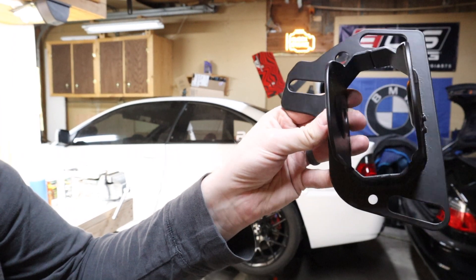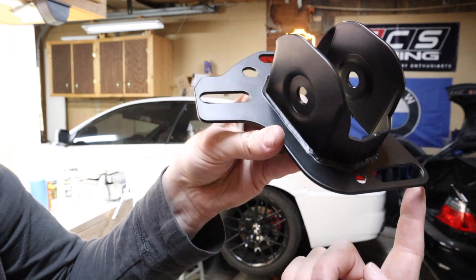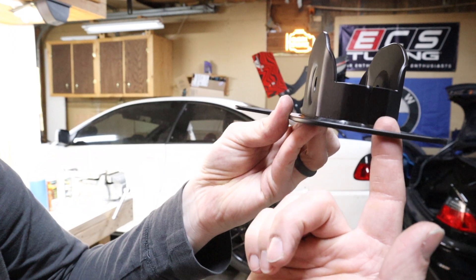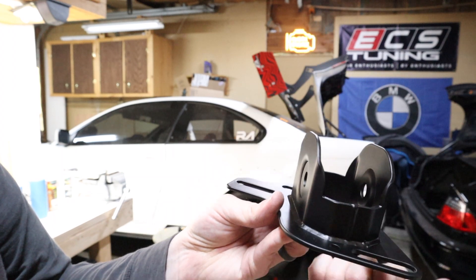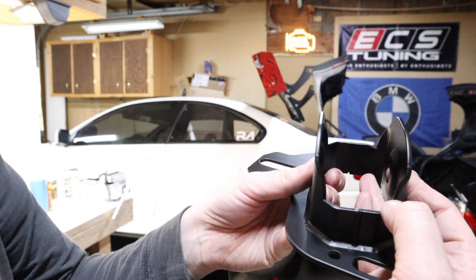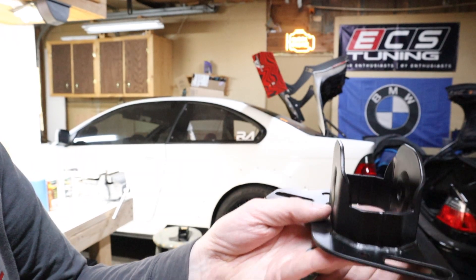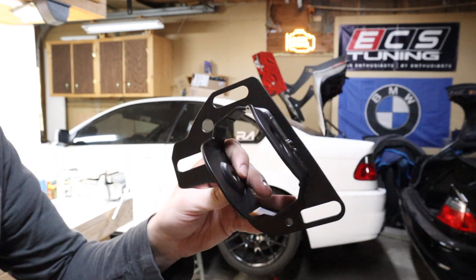Real quick, I'll walk you through it. These are in the car — there'll be three bolts: one here and then two more. Pull those out; I believe they're 18 millimeter. Once you drop the arm down you can kind of pull on it. If you need to get a crowbar you can push down on it, and then there'll be a bolt and nut through here. Once you remove that bolt and nut the old one slides off, you pop the new one on, push the arm back up, run those bolts in, and that's it. Super simple.